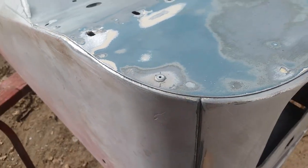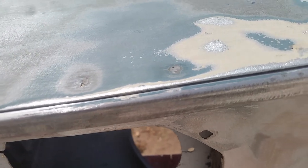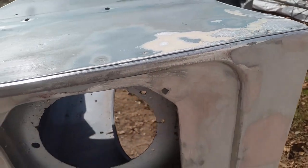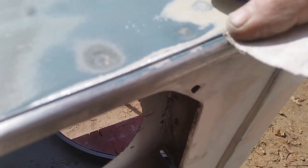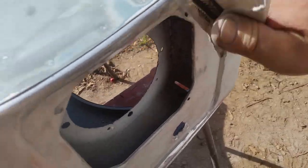Another feature of Land Rover bodywork is these long seams. I've had to devote a lot of time to cleaning these seams to get every last little flake of paint out, so that when I prime and paint it looks like the original coat of paint and you can't see any clues of other flaked coats underneath. It has to be done by hand — there's no way you can get in with a machine. There's a lot of scraping and sanding. I use a fairly rough sandpaper — this is all 150 grit. Anything finer and you're just going to take too long.